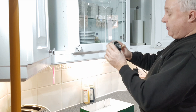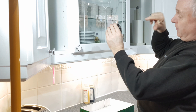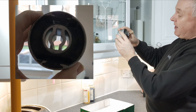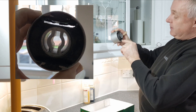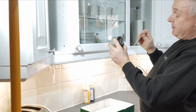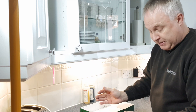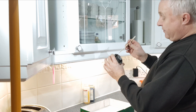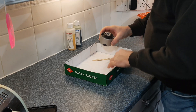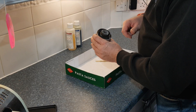First, look through the open portions of the bush and make sure you can see right through. I'll put a picture on screen — you can see through one side but not the other. What you're seeing in the middle is flashing from the moulding tool, because the tool is in two halves. With a knife, screwdriver, or some other suitable implement, burst through that flashing. Where we're going to achieve making this a heavier duty bush is to fill those cavities.